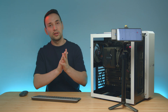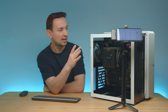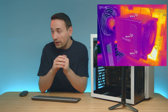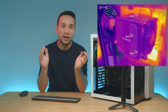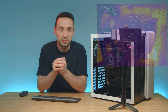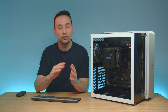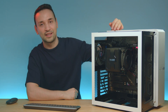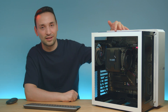We have everything installed here. We're going to go ahead and do some stress tests, and you're going to be able to see the thermals as the stress test goes on, just so you can get an idea of how hot it gets. Right now, the CPU — the way I have it set up — the 11900K on the BIOS has Turbo Mode on and XMP on. I'll put all the specs in the description below. Currently the room temperature is around 24 Celsius — it's not a cold room, so this is pretty much real-world testing.